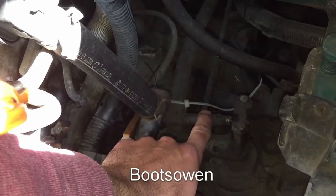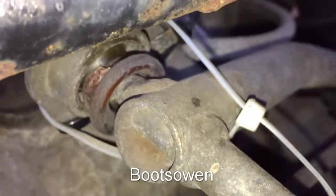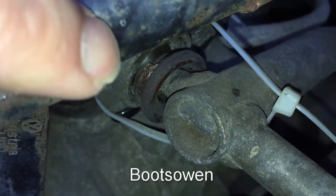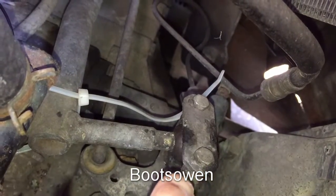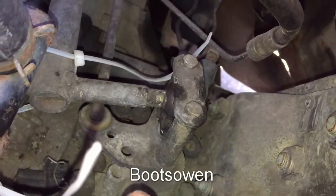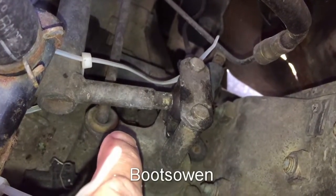And this one just goes up and down, so it pivots about a point in here. It pivots in that hole there. You can see that rubber has gone a bit crusty, and what happened was the back of it fell out and then there was nothing stopping this whole linkage just going sideways over to the left, and then this ball would jump out of this little selector box. So this thing rises up and down and goes in and out towards the camera.